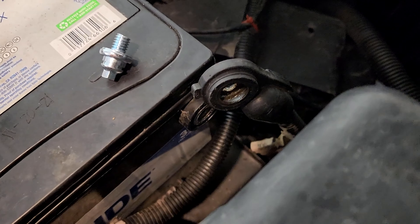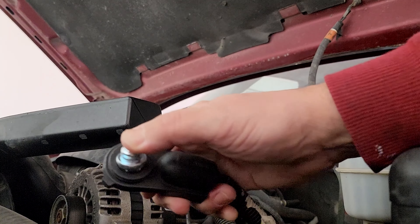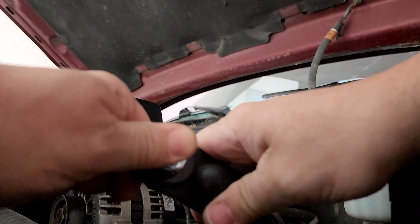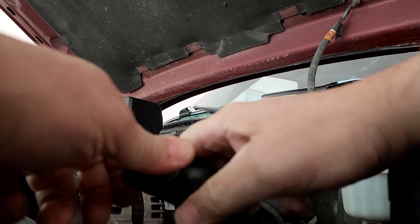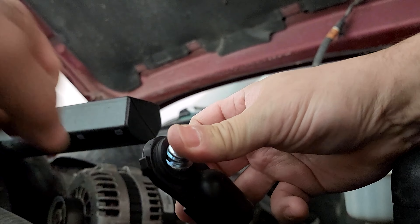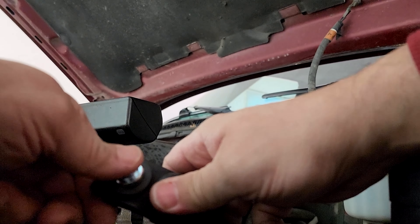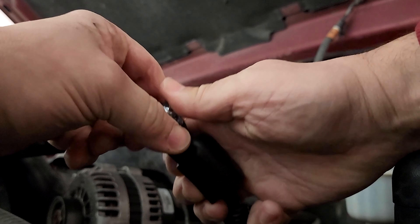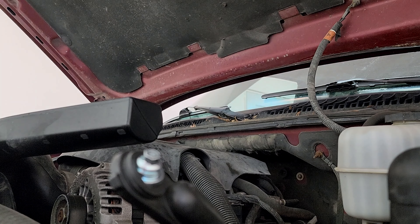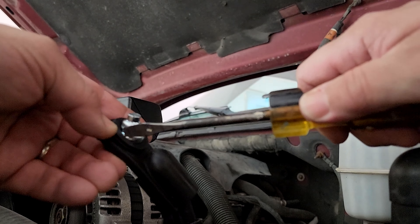Put a little machine oil or grease in there — grease is best because it makes better contact. I'm finding that if I put one of the edges of this bolt underneath the rubber lip, it starts to slide underneath. Getting it started is the hardest part, and this is why you want to be in a warmer environment — the materials are a lot softer and easier to work with. It started to get under. Once you start it getting underneath, the rest should be a little easier. The main thing is getting it underneath so it holds it in place and you don't drop it down into your engine.